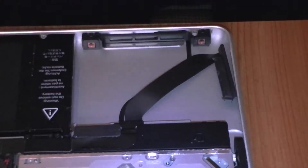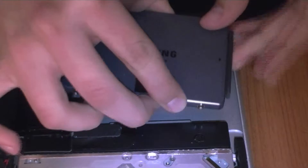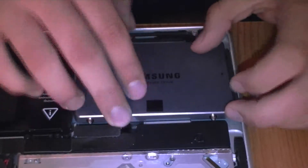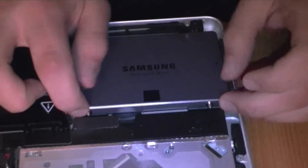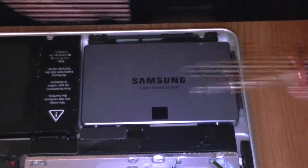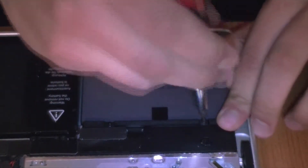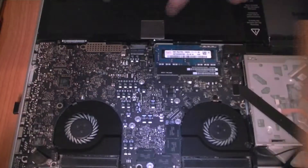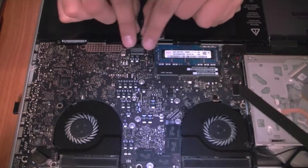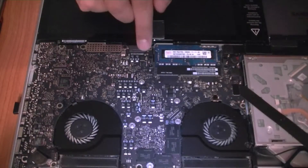Once the screws are in your solid state drive, carefully pick up the ribbon cable and fit it onto your solid state drive. Then using the screws that are attached to your solid state drive, fit it into your computer. Make sure that your solid state drive is fitted correctly. Once it is, get the Phillips triple zero screwdriver bit and reattach the bracket on top of your solid state drive. Then reattach the plug from the battery into your motherboard, carefully pushing down the connector so that you don't damage any of the pins.